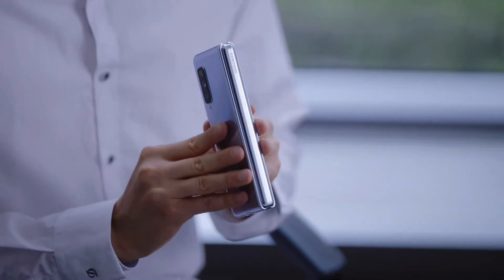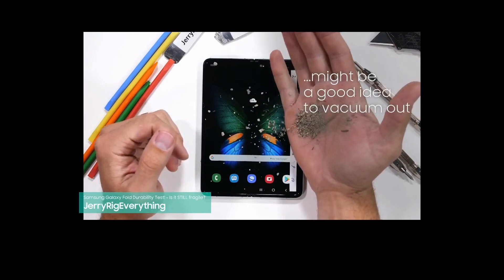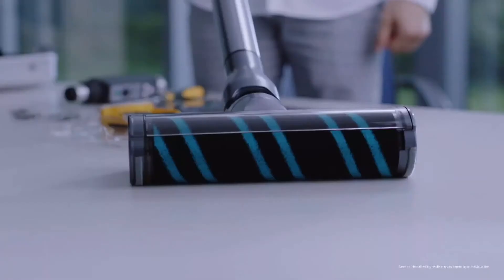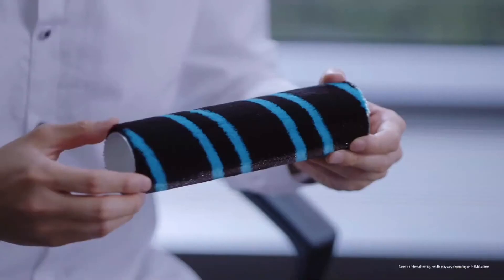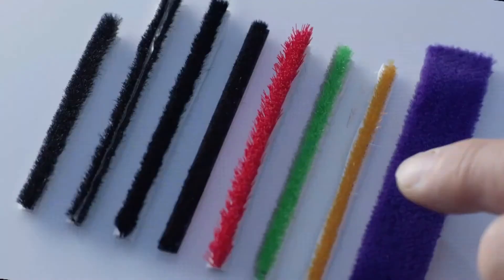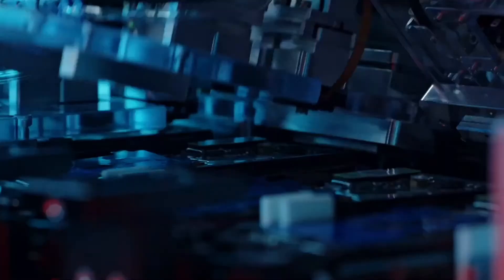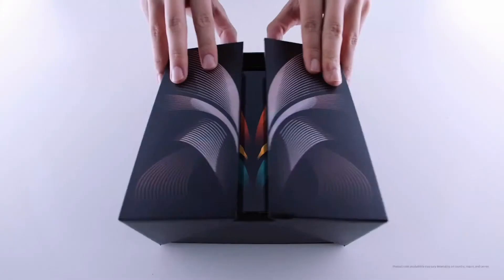For those components to have space to move, there must be a gap. So if you get this phone, it might be a good idea to vacuum out your pockets. To sweep away these worries, we tried out over 100 different ideas. The 99th try gave us a starting point, and on the 108th try, we invented what we now call the sweeper. We got the idea from a vacuum cleaner commercial — these machines use bristles made of carbon and nylon fibers that can rotate 20 times per second for two years. These fibers were elastic and durable enough to be placed under the hinge, sweeping through it with every move. Thanks to upgraded cutting technology, the sweeper became even smaller in the Z Fold 2. All these innovations come together in the user's hands, providing a whole new experience with strength and a sense of security.